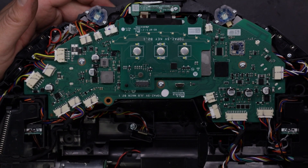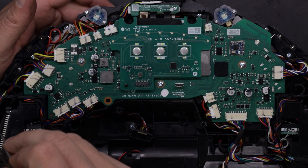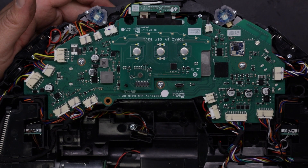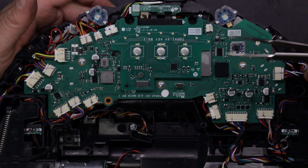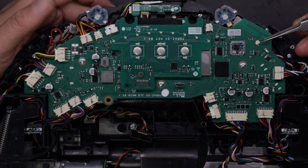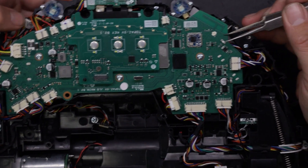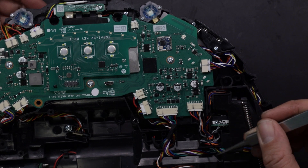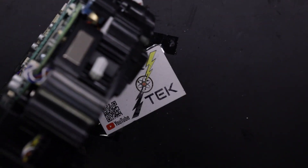So one of the problems I've got is the Wi-Fi connection is bad. And if you take a look at the circuit board here, you may be able to spot the problem. The person that was inside here the last time did not connect the Wi-Fi antenna. That should be connected here - this is the antenna, and the cable should be connected here, but there is no cable. I find the cable here. Hopefully I can reconnect it without having to take the board out.